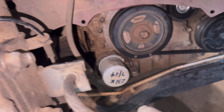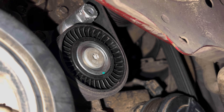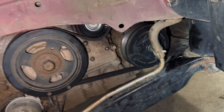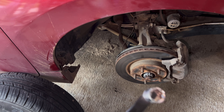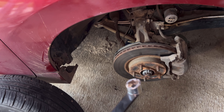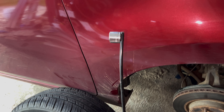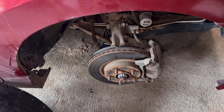After an hour — yes, an hour — of fighting to get that little nut so I could move the tensioner, I finally got the belt on. I had to take the grinder and cut the 17 millimeter socket because it would not fit in there. Tried to use box-end wrenches but they would slip because the pulley keeps the wrench from getting all the way down. I also put a slight bend in the tool so it would fit in there and I could get the tension off, because once I went to pull the pin the belt was not in place and the pin did me no good.